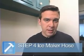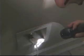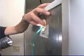There's one more place our leak could be coming from: the hose that supplies water to the ice maker. Let's start with the place where the hose attaches to the wall. In some cases these are rubber or plastic, sometimes they're metal. You want to make sure that you know how to turn this water supply off just in case we do something stupid and water starts squirting all over the kitchen. Now let's look at other places where the leak could be coming from. The leak could be coming from here where the hose attaches to the fridge, or it could be in this aqua-colored secondary hose that goes all the way to the top of the fridge and in this fitting right here.